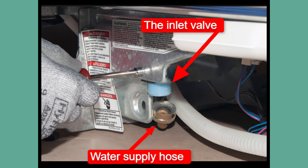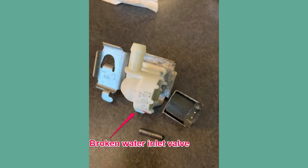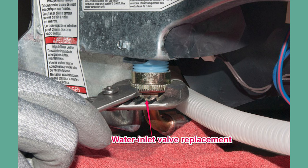If you want to know where this gatekeeper resides, it's not that hard to find. Usually, the valve will be at the point where your inlet hose connects to the dishwasher. Here's a picture of what I'm talking about. Once you're able to detach the inlet valve, it becomes easy to check it for damage and clogging. During this repair run, the valve was broken and needed replacement. A damaged inlet valve isn't worth the effort trying to fix — it's like trying to mend a cracked mug with tape, it just won't hold. So you'll need to replace it. But it's also important to note that a clogged valve isn't a lost cause — we can bring it back to life. If it's not broken or riddled with mineral buildup, it can still be fixed. Here's how to go about replacing or cleaning the valve.